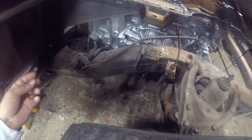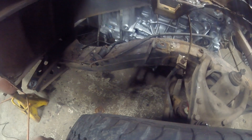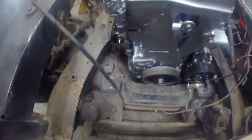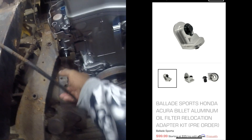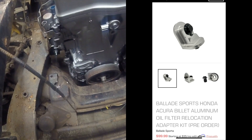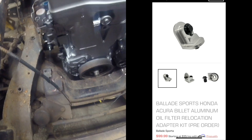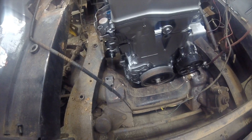Just so I can make one exit this way — if I have to cut the frame around here, I will, I'll cut it and weld it. I'm trying to keep the stock location for the clutch master cylinder and probably run the turbo downpipe through the back. Another problem is the oil filter — I'm going to need a 90-degree adapter. The 2006–07 filter is very small but it's a tight fit, so that's another $90 to $100.